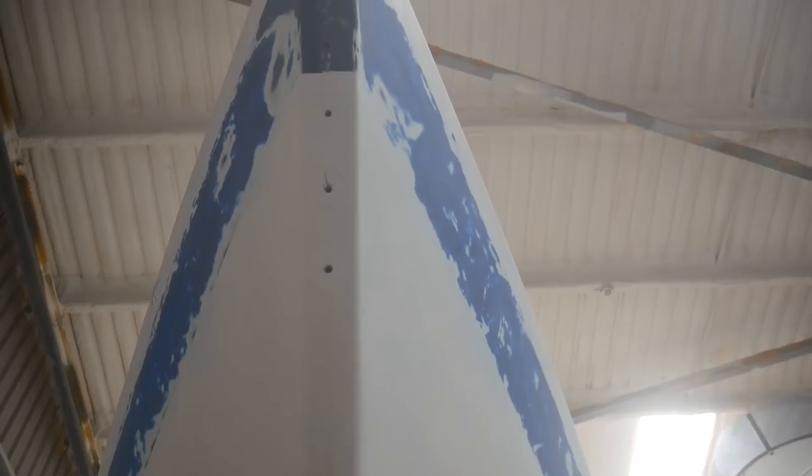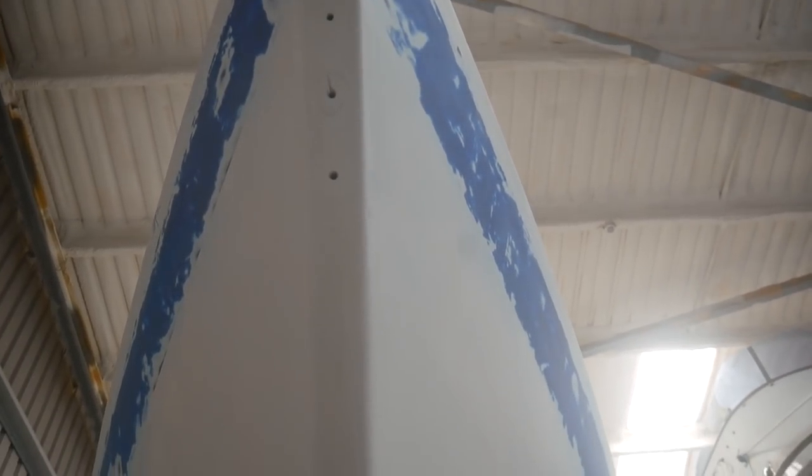So there's a couple of things on the hull. There's obviously little holes like that, some parts where we're through to the laminate like that, there's a couple of little chips around these bolt holes for the main chain plate there, the fore-stay chain plate. Now here you can see there's some pin holes here, but these have actually been filled in previously, so obviously Wanda's already had one respray.